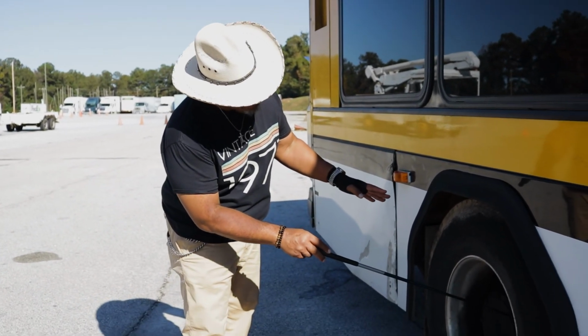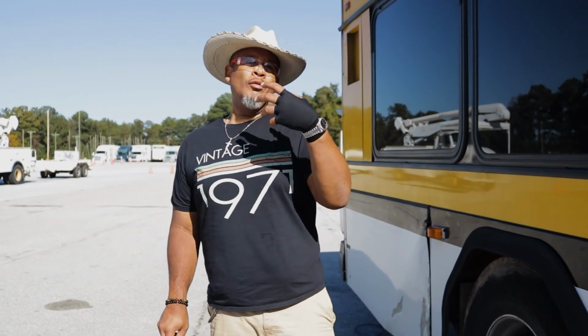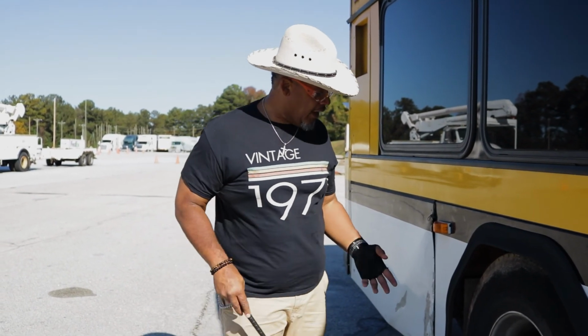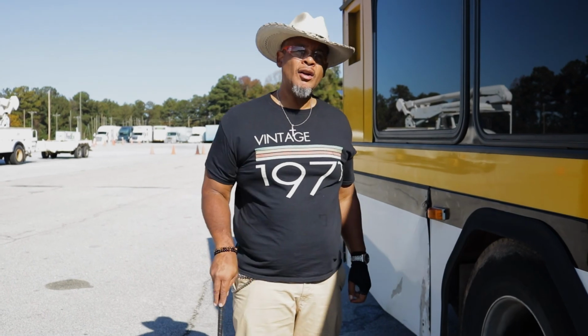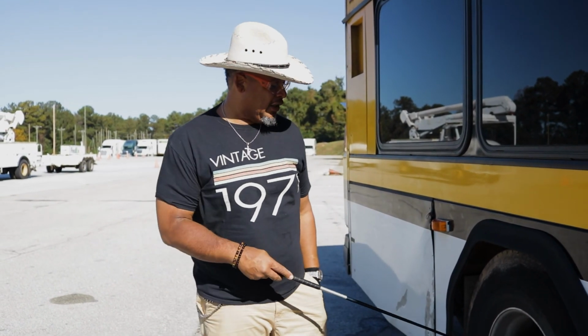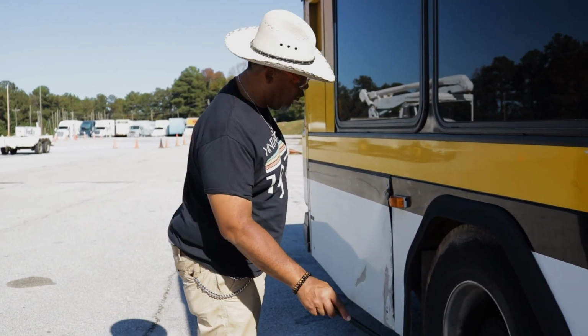And I have my lug nuts, properly mounted and secured, not cracked, bent, or broken. There's no running rust or shiny thread that will indicate looseness. I have my axle seal back here, properly mounted and secured, not cracked, bent, or broken. All hardware is present. It's liquid in it, so I see no leaks. I have a splash guard back here, properly mounted and secured. All the hardware is present.